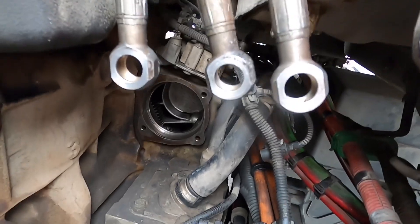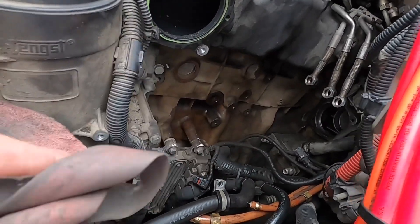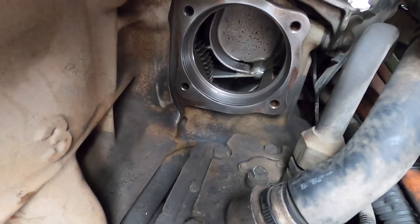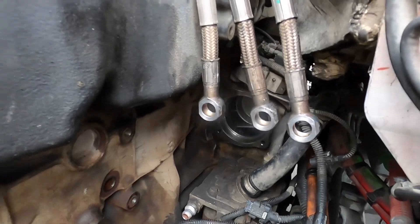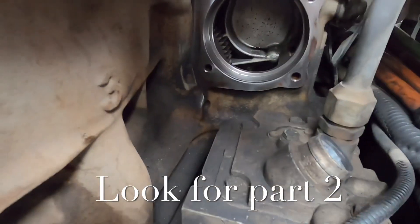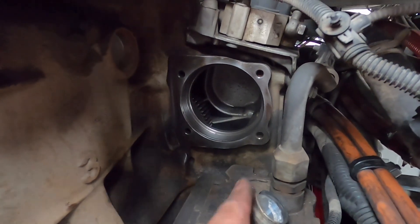Get the fuel pump ready to go — a little bit of brake cleaner on a rag, light sandpaper to clean the mounting surface. Lubricate the O-ring, which I'll show you, and it should just slide right in. I'm going to get some of these accessories out of the way and then put it all back together. With that hose and the lip it has moved out of the way, it should hopefully let me slide that pump right in there as easily as possible.